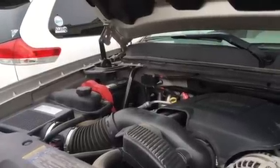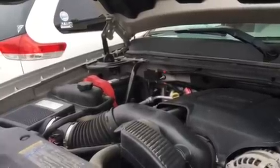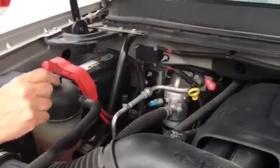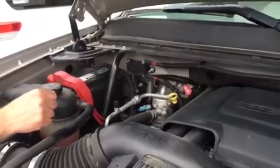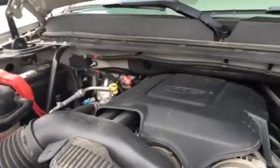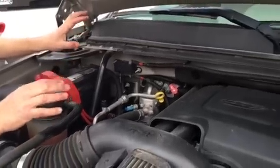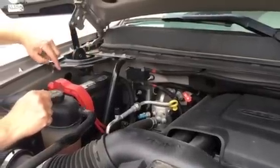I started having the problem again, and I looked on YouTube and there was a video for it. This guy had an older one and there was a wire leading off of it that needed to be replaced — basically a ground wire to the body. But since it was a different year, it wasn't easy to translate. So what I ended up doing after some trial and error was going through every lead from the battery to the engine and to various electrical connections that I could find.